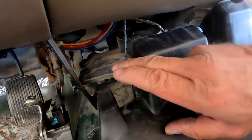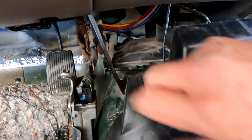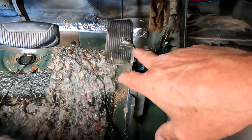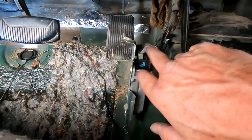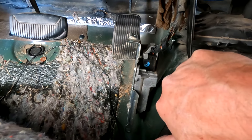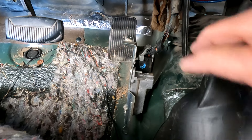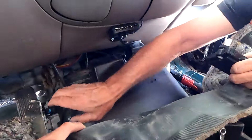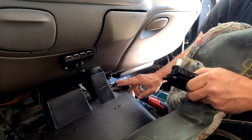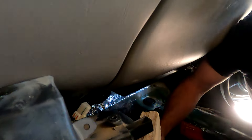When you put that side on, which everybody likes to try and can't get that thing off and break it off — we'll show you how to put it back in. This is your little airbag unit, three bolts. And then you kind of have to wiggle up and down because it's kind of jammed in there. You pull that out, then you can yank this forward. You don't need to yank it all the way out — most people yank it all the way out, just wastes time.